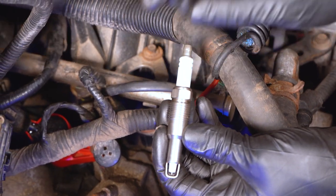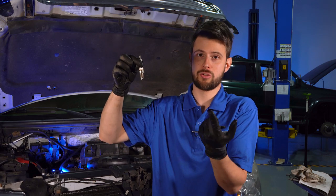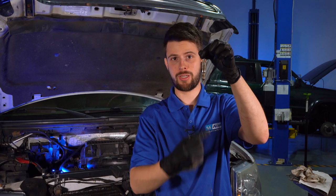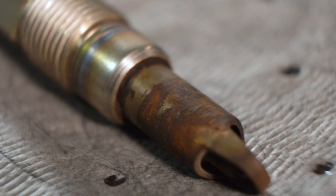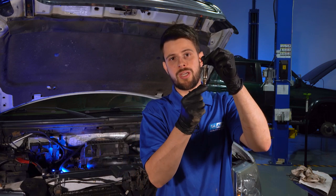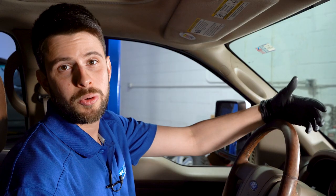Now you're safe to install your new spark plug, which you can get at 1auto.com. Now that we have our problem fixed and the new spark plug is installed, let me explain why and how these break. When Ford redesigned the spark plug from the 2-valve — which is just a normal looking spark plug — to the 3-valve spark plug, it got this longer shank on the bottom below the threads. The seat of the spark plug is here and this part sticks down into the cylinder. What happens is it gets built up with carbon here over time. These are platinum spark plugs supposed to last a long time, so you don't just change them every other oil change. With these being in for a long time, and since this is also two separate pieces, the carbon basically locks this piece in, and as you unthread it, it will break apart. That's the only reason they split — this cannot pop out of its machined location in the head and you're just left with the top half.